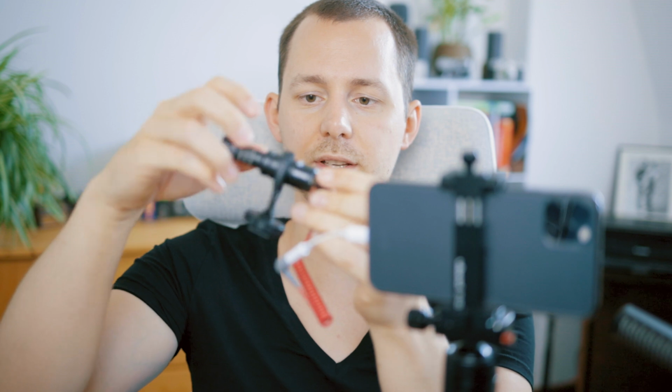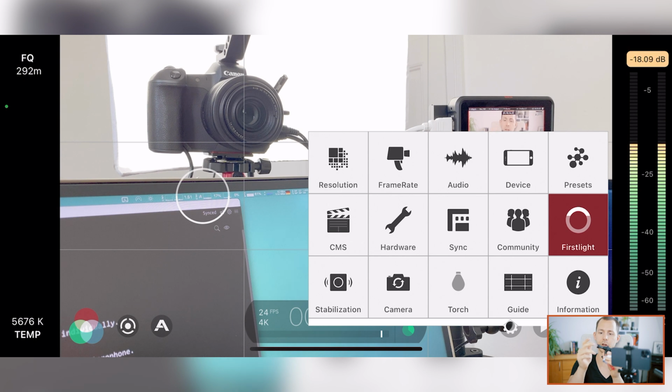So as soon as we plug in some cable that is also a TRRS here, we have this at the other end. And now we can actually plug in a microphone, like, for example, the Rode VideoMicro right here. And now, once we have all this set up, what we will notice is that when I scratch at the front here, we will actually get the audio from this microphone. And to make this as a comparison, before I had to touch the iPhone here, and that was really showing the signal having a huge spike, but now that's no longer the case.